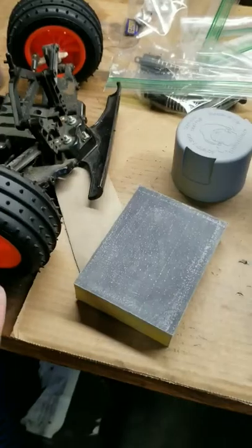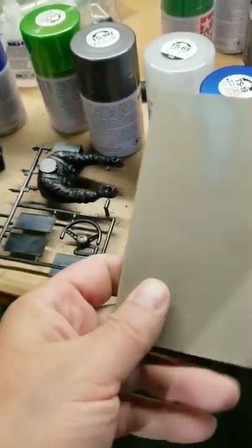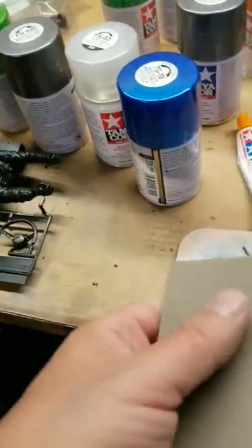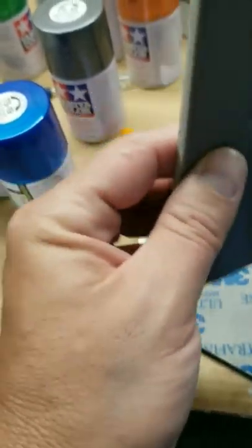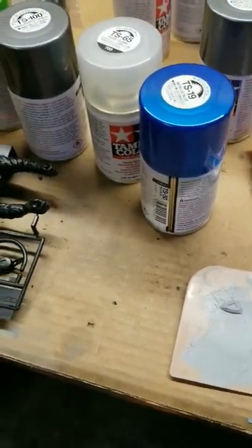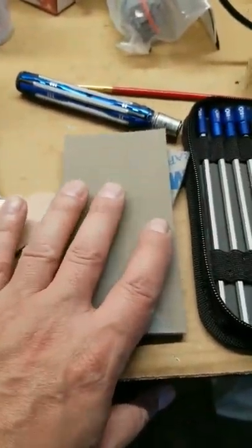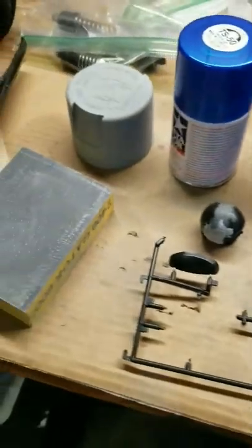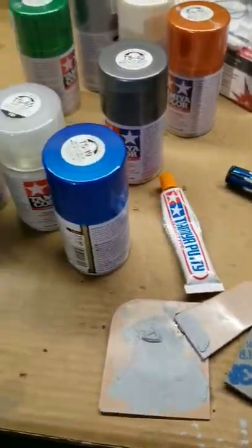When I was happy with the results, I used these — they're 3M foam ultra fine, 800 grit blending pads. You use this to blend the putty into the body of whatever you're working on. This does a fantastic job of really smoothing everything out and getting rid of all those fine cuts. Once you're satisfied with your initial knockdown and you're almost ready to primer, go over it real easy a few times with the 800 grit, get all that excess off, and it'll really touch up your finished job. Now I'm going to get back to primering the bug.